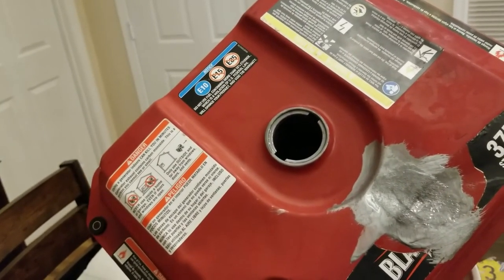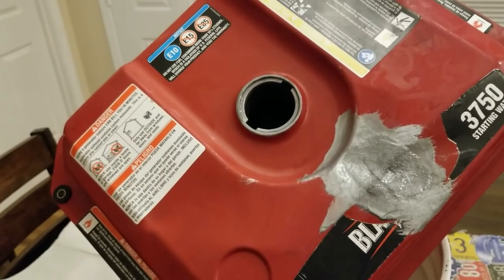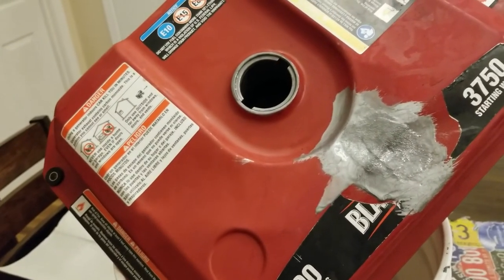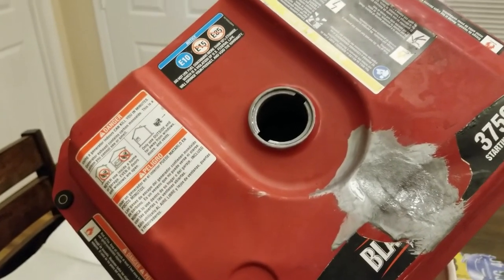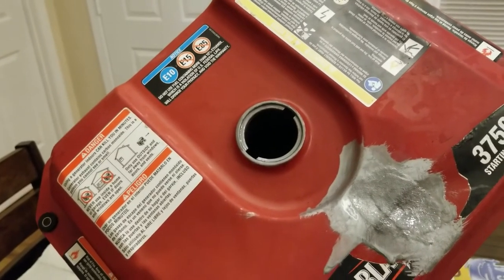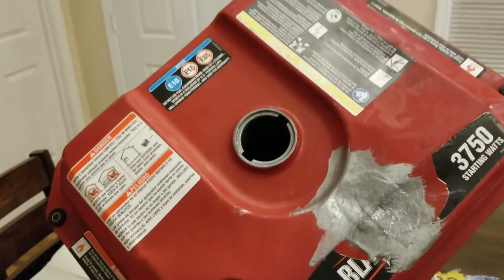Just let it sit in a well-ventilated area — don't try to heat it up with a heat gun to make it dry faster, don't try any tricks to speed it up. Just let nature take its course, let it sit for five days and it'll cure. When it's done curing, test it with water first, and after you've confirmed it's sealed then you can test it with gas. I'm probably just going to put gas in and skip the water test — I feel confident in the seal. But the directions do say to test with water first. Anyway, it's just a waiting game now — leave it alone for five days and see what happens.